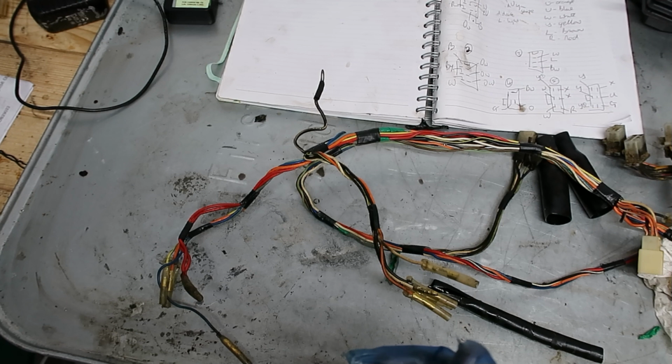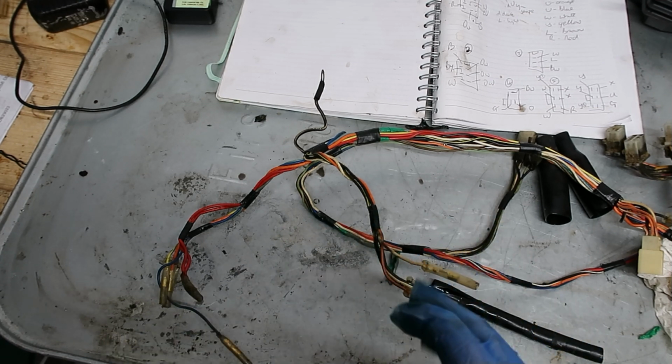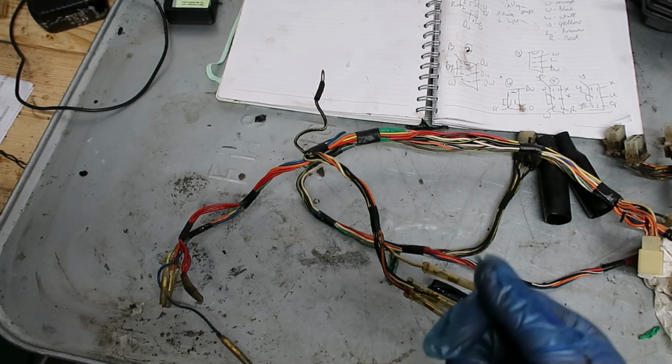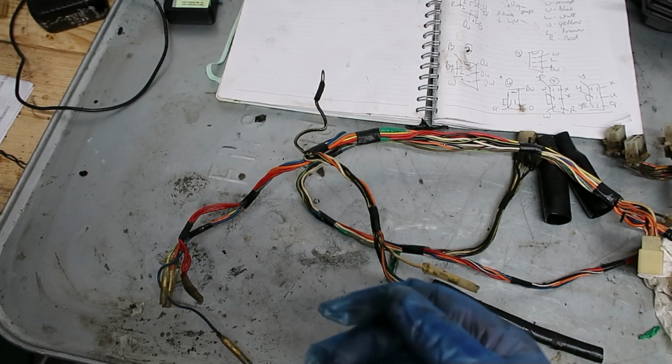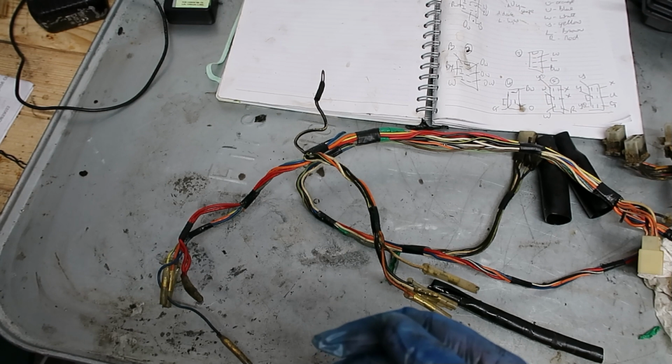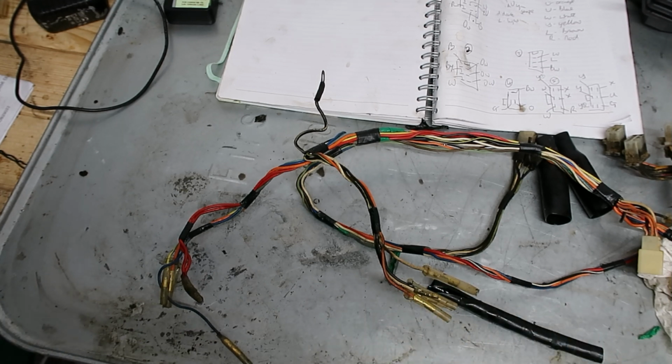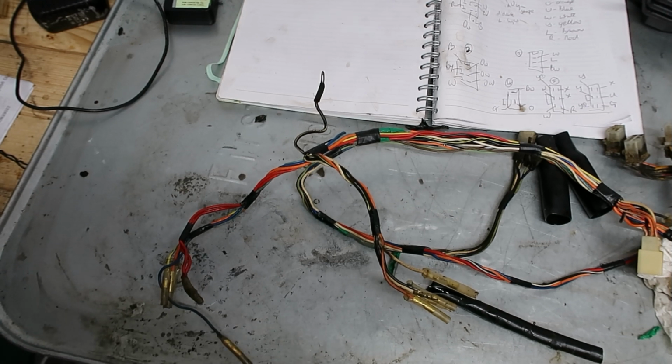On a 6-volt bike you're in a massive world of pain, which is why on all the 6-volt bikes I build, because of powder coating and how efficacious powder coating is in creating insulation, I always run a new completely separate earth front to back. So it's not used in the frame as the earth, it's now used in this separate earth, which takes it directly to the battery. And that helps massively, yeah, it really does.